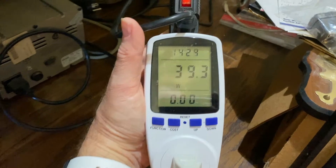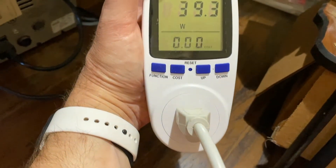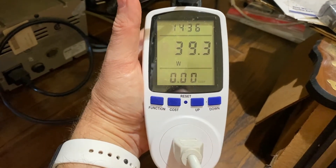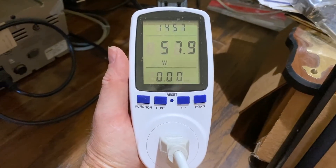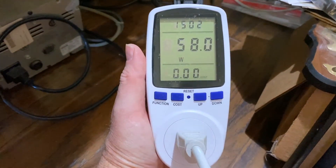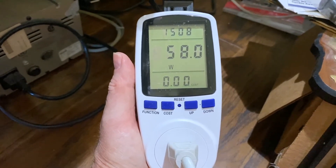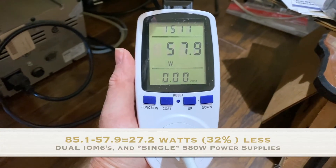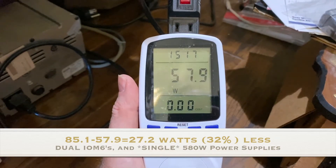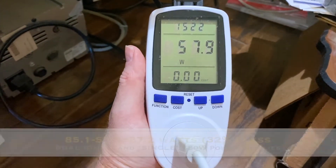Let's unplug one of these power supplies — the top one. Running off just one, I believe the total draw is going to be less. So if you want to save some power, let's take a look. Yeah, so as you can see we unplugged that top one. Now we're running two IOM6s on just the single power supply. The DS4246 runs the other fan off the first power supply, but we don't have the wasted current, so instead of 70-something watts, now it's 50-something.